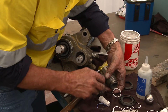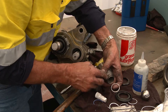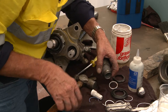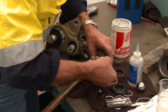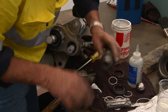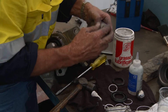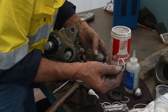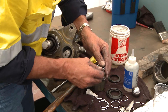If the pressure escapes out that damaged edge, you'll have problems. If you can't get the o-ring off with your fingers, use a small screwdriver or a pick, get underneath the o-ring, and flick it off. The majority of them will come off with your fingernails. For reassembly, make sure those ring lands are nice and clean prior to putting your new o-ring back on.